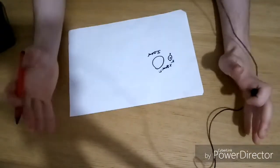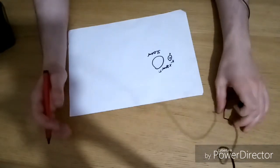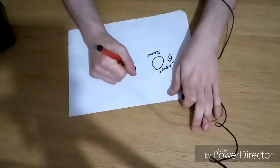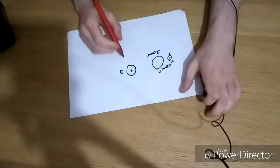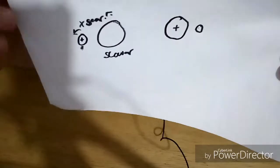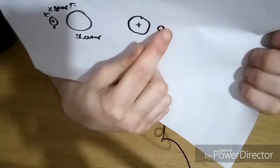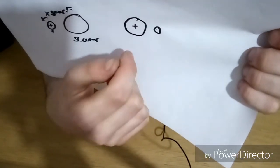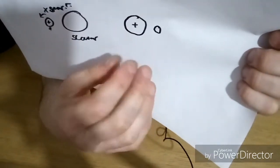To get power slash speed, and the reason I say speed slash power is because power is equivalent to speed. If you don't have power, then you don't have speed. Then you just switch them around, to be honest. So you have a bigger gear on your driver gear, which is again your motor, and a smaller gear on your differential gear. And this little cross here is to tell you which gear is the driver gear, which one's the differential gear. Switching around them means that this gear will be spinning much faster than this little gear here, and this little gear here will be spinning a lot less to turn the wheels, if that makes sense. So it'll have to be working less to turn the wheels. So again, you're just going to have an overdrive of speed slash power.